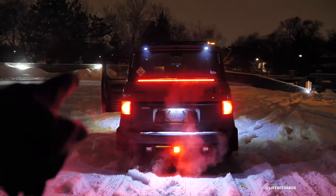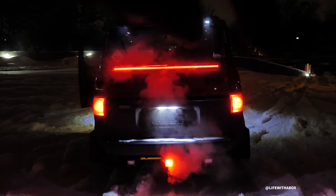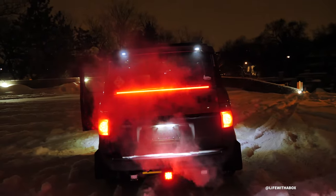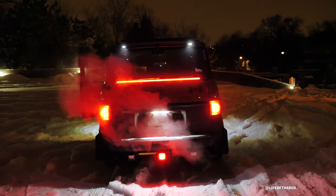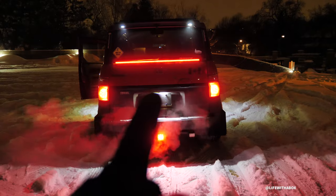This is the LED strip — these are quads, meaning it has two reds, a white, and an amber. When I brake, the red lights turn even brighter. If you buy a regular strip it may come with just one strip of red, but this comes with two, so it's more prominent — people are going to see that you're braking. When you put it in reverse it turns white. I've got two LED bulbs for the brake lights, an LED tag light — I ripped all the internals out and put in one strip, like a mini LED light bar.